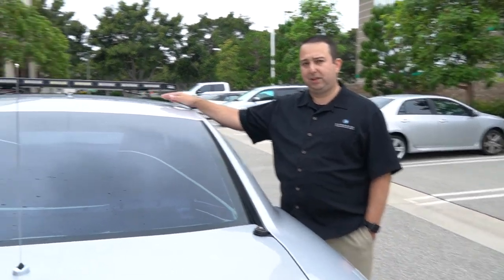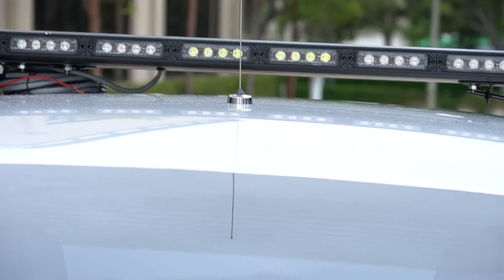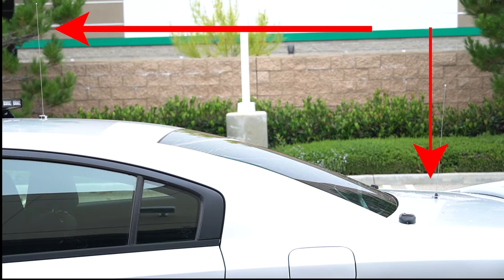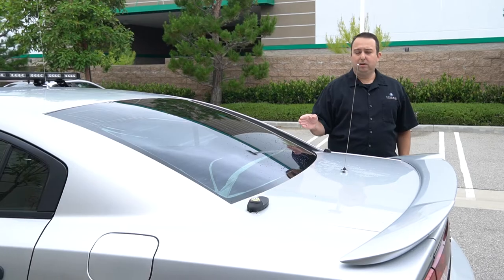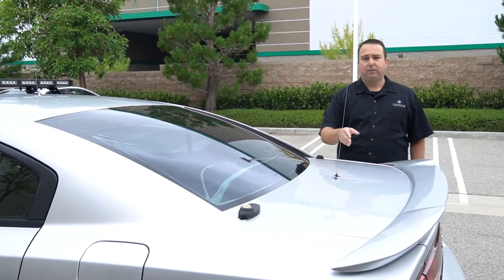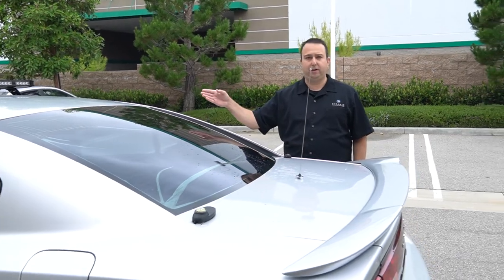Let's talk about the proper place to install your antennas. More often than not, your mobile radio antenna is going to be installed on the roof of the vehicle. A good place for your vehicular repeater antenna is on a separate ground plane — the trunk is a good option. You want to have as much vertical and horizontal separation as possible between your mobile radio antenna and your vehicular repeater antenna. In this installation we have quarter wave antennas for both the mobile radio antenna and the vehicular repeater. This is a common installation for your vehicular repeater and your VHF mobile radio.